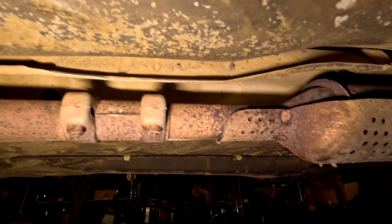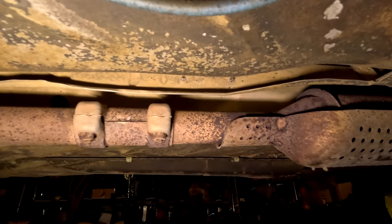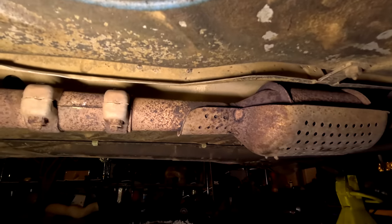The last thing I want to try and do tonight is get the automatic shifter box out and the manual one in. That way tomorrow it's just transmission in, hook everything up, and we're pretty much home free — minus figuring out the throttle cable and a few small things. To get to the shifter box we have to get under the car, undo the exhaust, drop the heat shield, then undo four bolts and two on the top side, wiggle it past the exhaust and it's out.